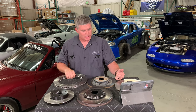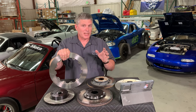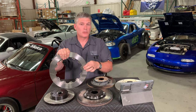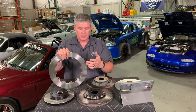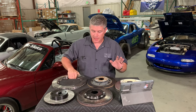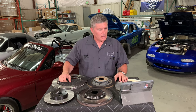The actual shape of the slots — on some race cars you see little J-shaped ones and different variations. I'm pretty sure you get 99% of the effectiveness from just a straight cut, and more importantly it's much easier and less expensive to machine. For a race car where cost is less of an object you might spend extra money if there's some benefit from odd shapes, but I haven't seen actual documentation on that. The reason you see straight slots on most street-car-based stuff is simply cost.